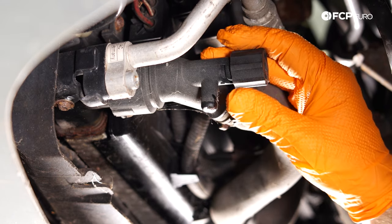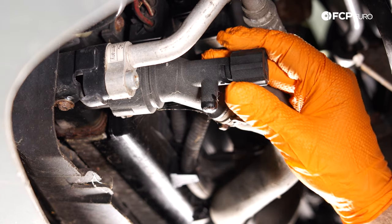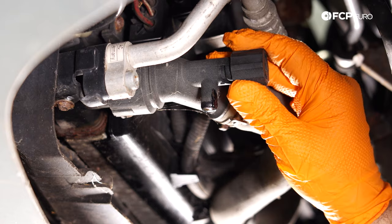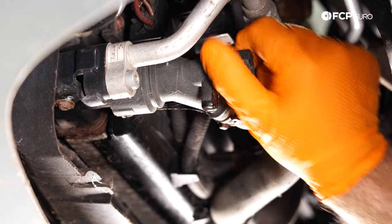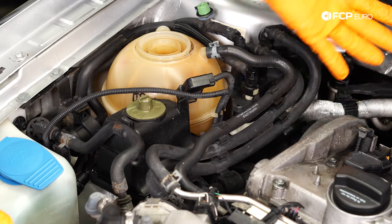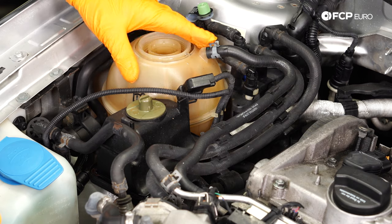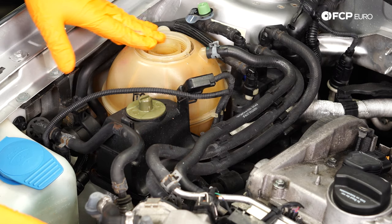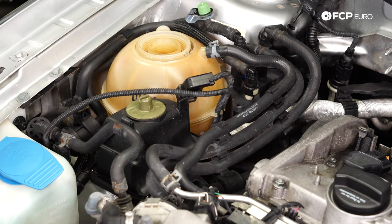There was little to no coolant that came out. I wanted to make sure we cracked the reservoir cap on the upper reservoir — that's going to release any type of vacuum. There's not much coolant coming out regardless, so it's drained. We're going to be focusing in the area around the timing belt. The general idea is to get rid of and move out as many components as possible, just so you have the best amount of access. I'm going to start with removing the coolant expansion tank here, so I'll just take off this hose clamp and move that down.